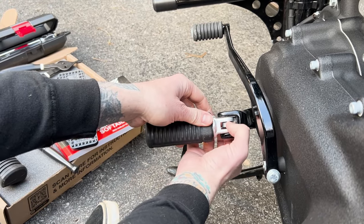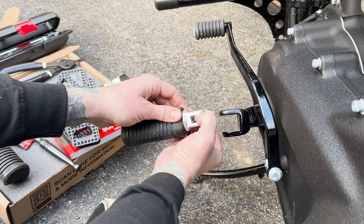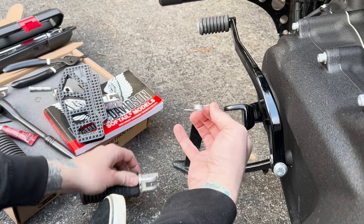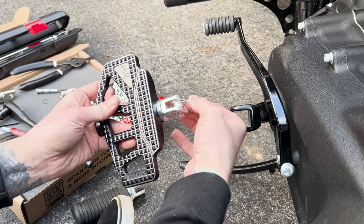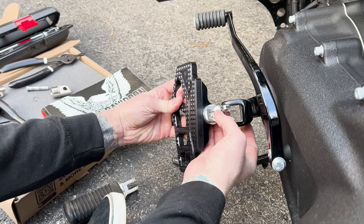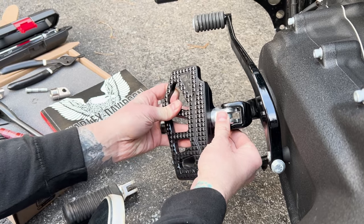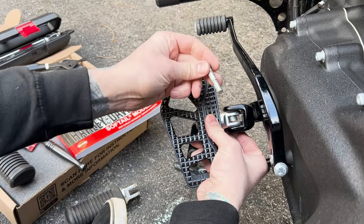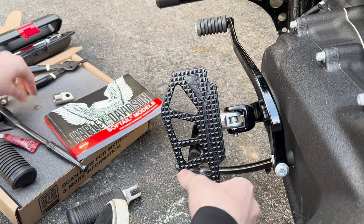When you do pull this off, just pinch with your fingers because you want to make sure that you have the orientation of the spring the same way. When it comes off, sometimes it just flies apart — total yard sale. You can see what part you need to go into your clevis and it just replaces like that. It's a simple swap right here. Align those pins at the springs, a little bit of space there — there you go, now you got the tension in there. Replace your clevis pin down inside. Boom, just like that.